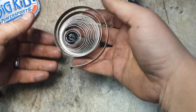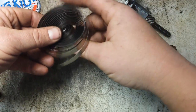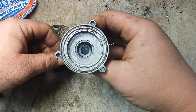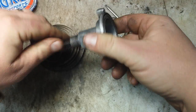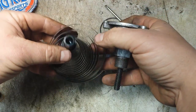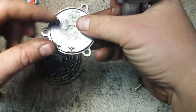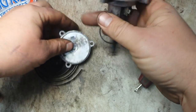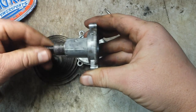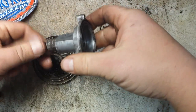If your spring is damaged, at this point take it out. This is the little attachment that the spring attaches to. On the bottom of this screw you'll see a hex end that fits inside this cylinder — that's what connects the two together. The spring rests against that, so when you're tensioning this, it's putting tension on the spring.